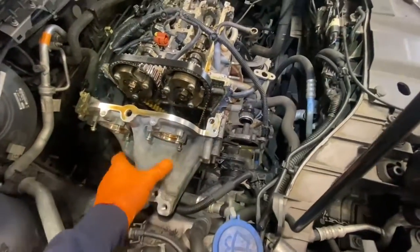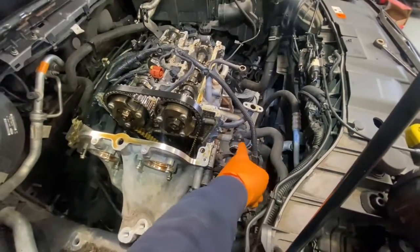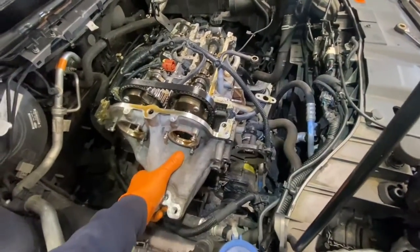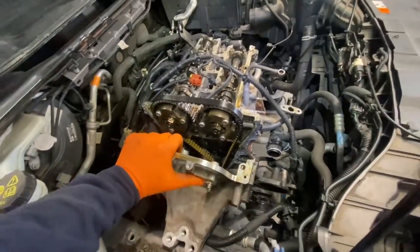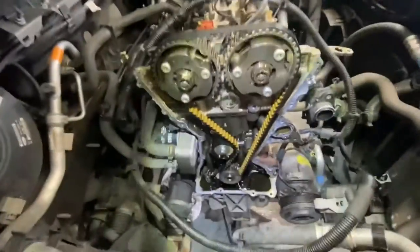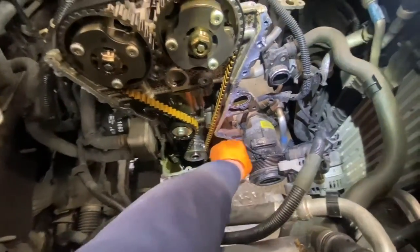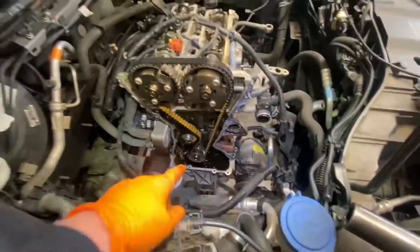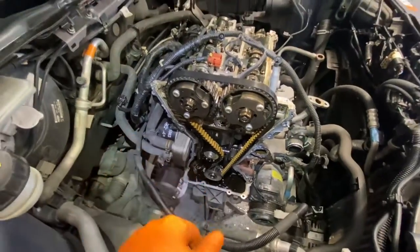All the bolts out — I had to loosen a couple of bolts in the air conditioning pump and then a little wiggle and woggle, two bolts out of the water housing, and out comes the timing cover. Simple as that. On the last one I had to take off the sump for the oil pump belt — on this occasion I don't have to.